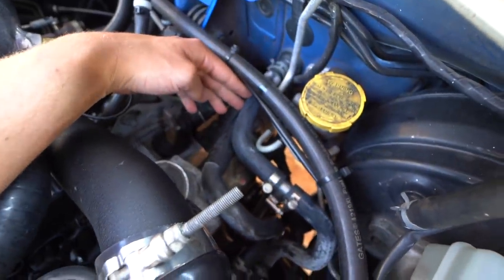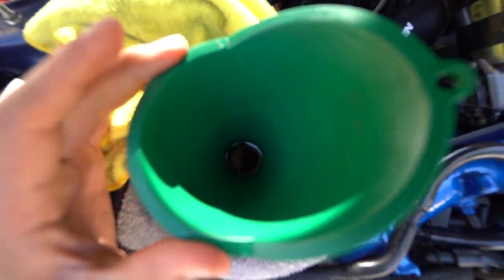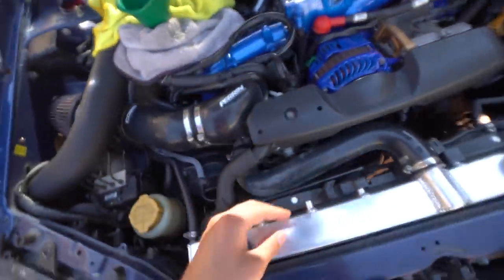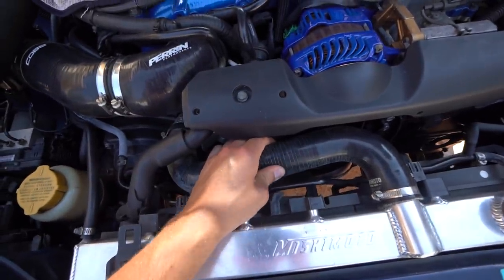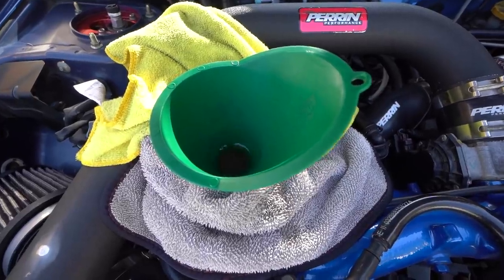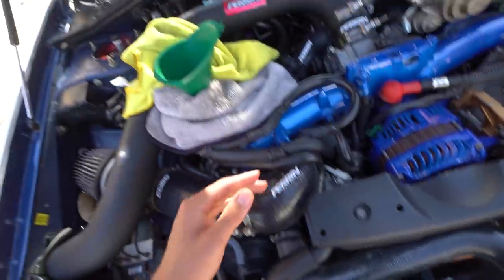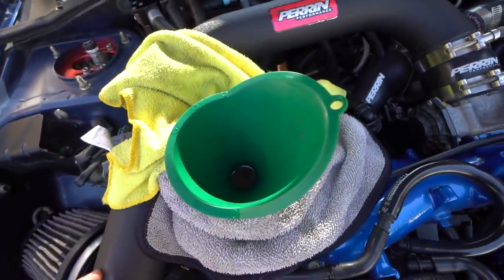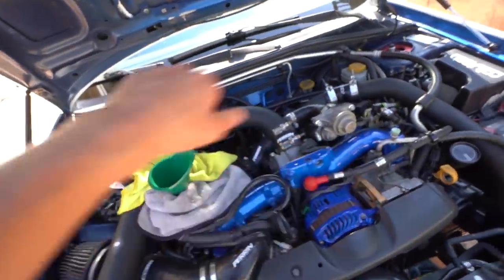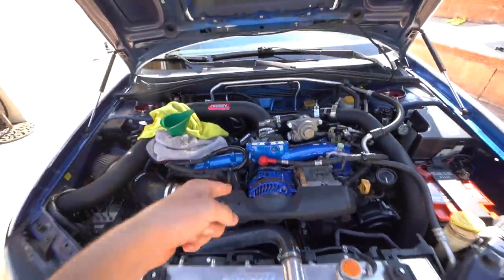I've topped off the coolant and it's now at the very top. How I got it draining — you can create a kind of vacuum by squeezing the upper hose, and the more you do that the further it will go down and fill up the entire system on the engine side. It's probably about a gallon or so. Now we're going to start it up, get the heater on full blast, get everything circulating, hopefully get some bubbles coming out, then go for a drive and see what the temps are.